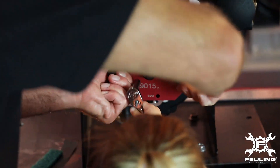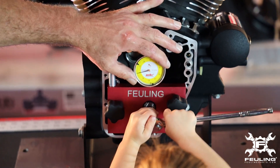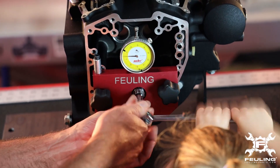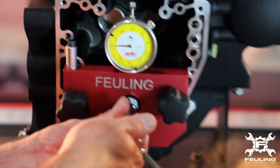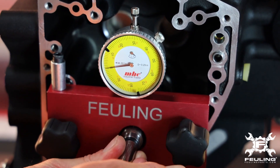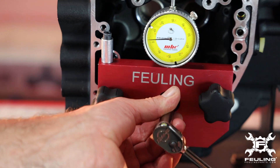Hattie's got the ratchet, so we're going to rotate the crankshaft. I'm going to set the dial indicator to zero. I'm not sure if you can get a good look at that dial indicator, but this crankshaft is pretty much toast. It looks like we have roughly seven thousandths crankshaft runout.